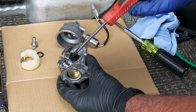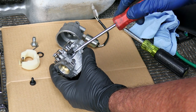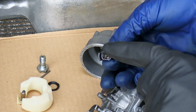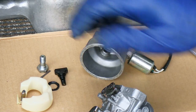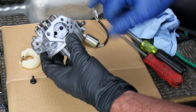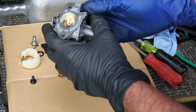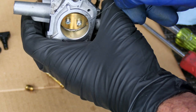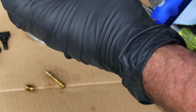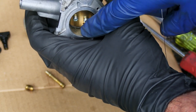This is your idle screw. Take this out first and right here, pop this off very gently because there's a rubber O-ring there that you don't want to damage. We have another jet down in there that you're going to want to clean out, and also you're going to want to clean out right here. What I would usually do is take some carburetor cleaner and spray it through every hole that you can find - every one. And then go behind that with some air and blow through those holes. Over here we have some little bitty holes, and you're going to want to take a set like this that comes with all these little different sized rods - find the little tiny one that fits and then put the rod through each one of these holes. Don't forget about these holes. Then blow some cleaner through there and blow some air through there.